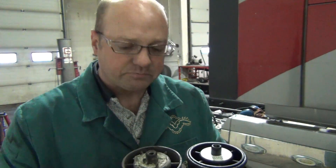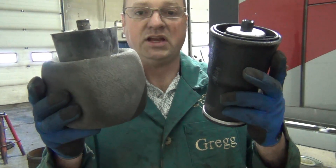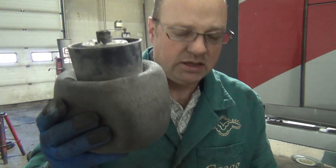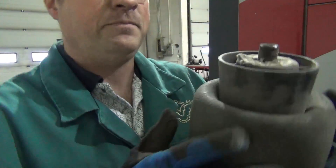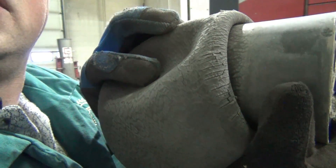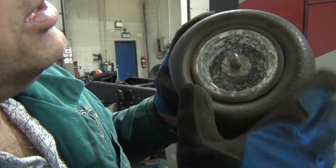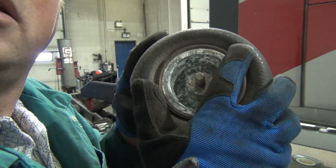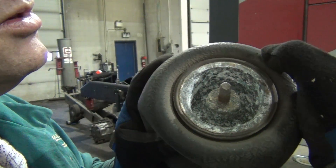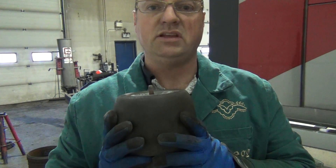We're replacing the airbags underneath the sleeper right now. We've got one of the old ones removed and here's one of the new ones - it just hasn't been aired up and stretched yet. I want to show you a little bit of wear. If you look at the bottom edge of this airbag, see all those cracks? This one was definitely due for replacement. I was even looking at the top of the airbag - there's the start of a hole on the top edge. So it's a good thing that we were replacing these. They were due.